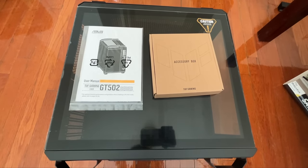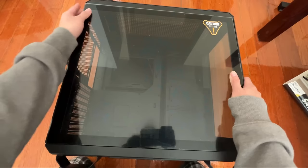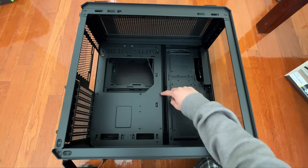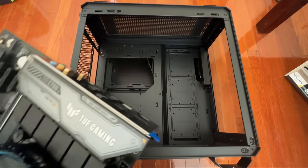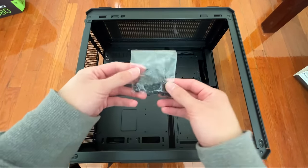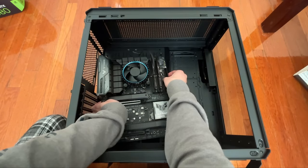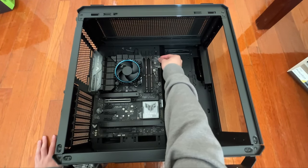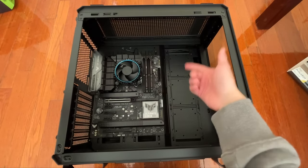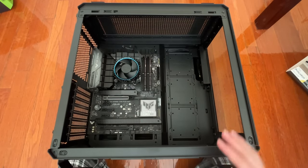So now we're going to be connecting the motherboard to the case. This is the Asus TUF GT502 case — this thing is huge, that's why I put it on the floor. First I'm going to take off this glass cover. Since my case already has these screw standoffs installed, I don't need to manually put them in. On the motherboard, you want to connect this silver I/O shield part with the empty spot on the case. You'll also need screws to screw it in. I gently lowered the motherboard down and made sure the holes were aligned. Now the motherboard is set up in the case — it wasn't adjusted correctly at first, so it was hard to screw in, but now it's all good.